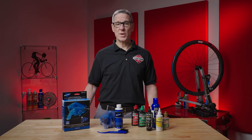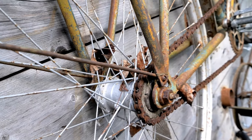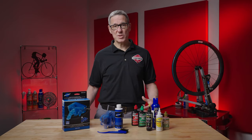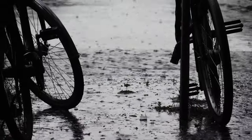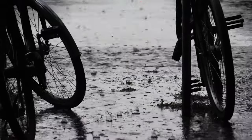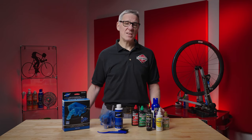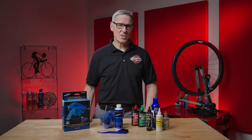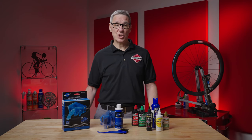The first thing we have to talk about is when you should lube your chain. If you get to the point where your chain looks rusty and sounds squeaky, you're going to need some chain lube. Similarly, if you have a lot of build-up of gunk on your chain, you'll be limiting the life of your parts. Water, sand, and dirt are the enemies of your bike parts. If you ride in wet sloppy conditions, you'll need to clean and lube your chain more often — maybe every few rides. If your chain is all black and gunky, you should clean and then apply more lube.